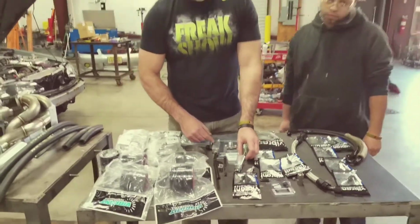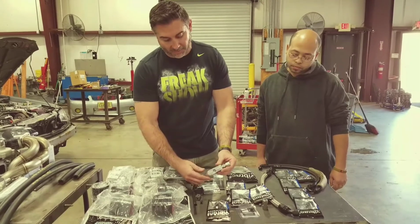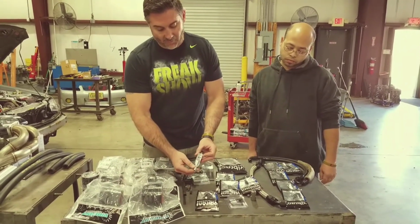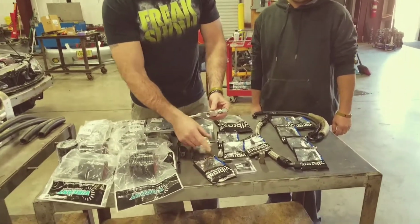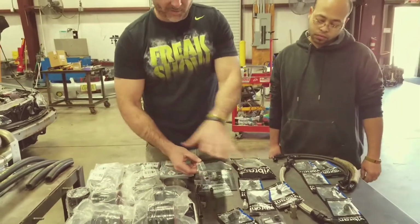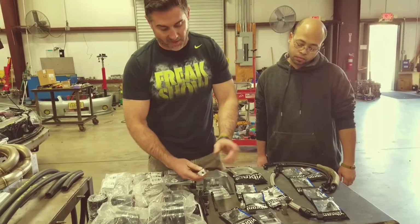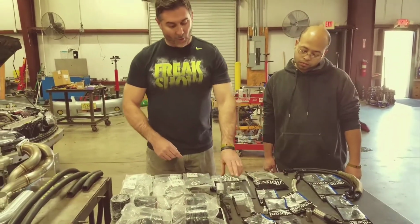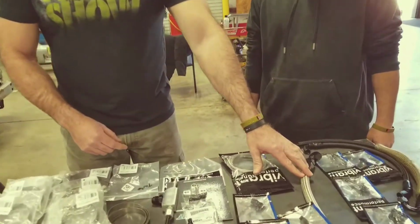Next, we've got the oil drain, the billet oil drain that we created. This actually uses the dipstick drain, right? And the fitting here with your Teflon tape is going to screw in here. And then Robert will walk you through, once we're done with going through all this, how you cut your dipstick tube and the compression fitting and all that stuff and the O-rings that are there. Oil drain on the bottom of the turbo, which connects to the stainless line.